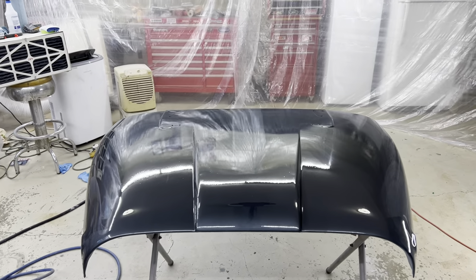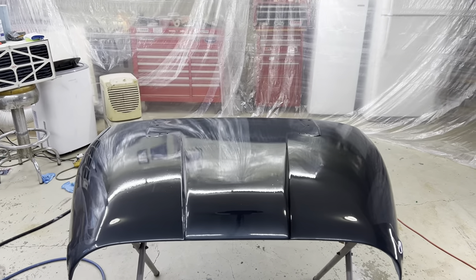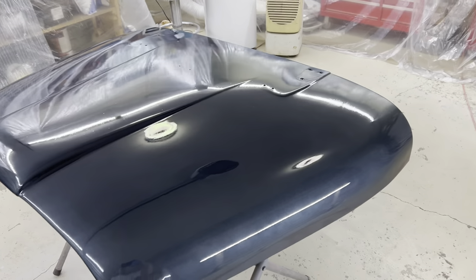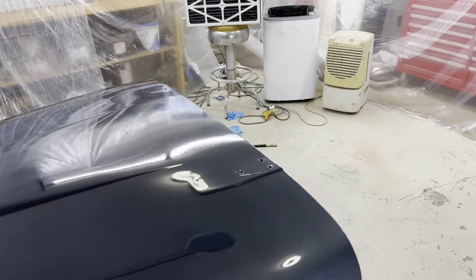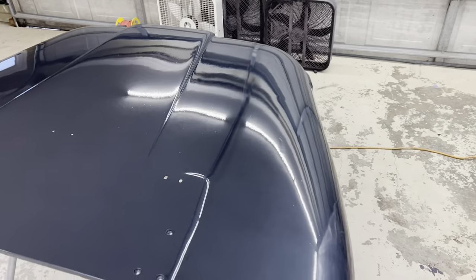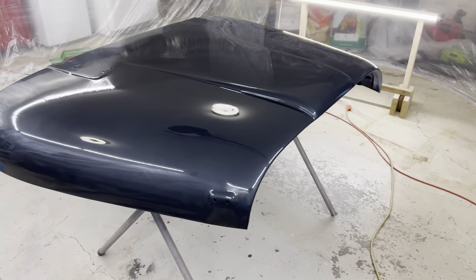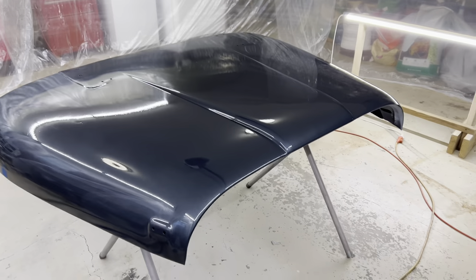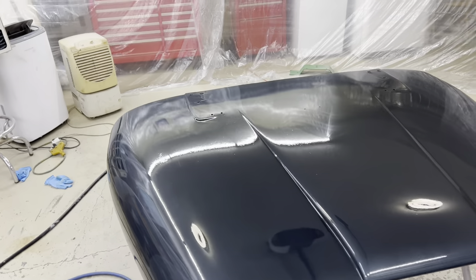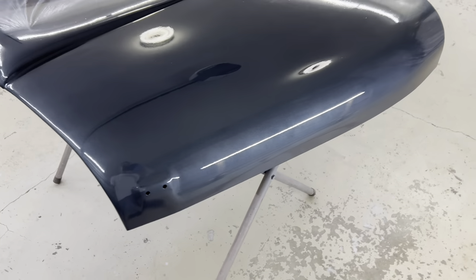It's June 21st, Tuesday morning. I just put two medium coats on and then a mist coat on this hood with about 10 minutes flash between, after I sealed it of course. And it looks pretty good. There's some places I can see where I had a couple of minor things, not a huge deal though. It looks like the metallic has laid out pretty consistent throughout.